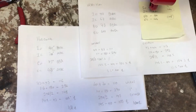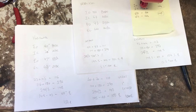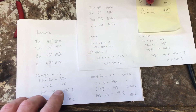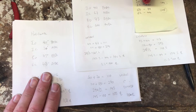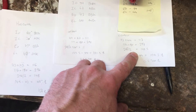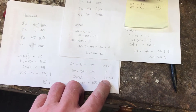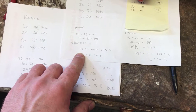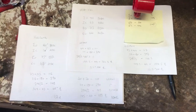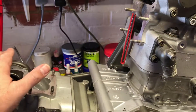If I then look at where I am with all these sets of cams, I've got an engine that's really messy on its timing — all over the place. So on the exhaust it's bang-on on the horizontal, but I've got half a degree advance on the vertical. On the horizontal intake I'm one degree retarded, but on the vertical I'm two and a half degrees advanced. So that's the timing checked.